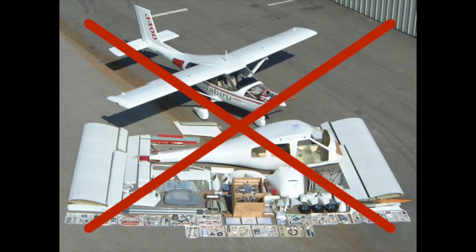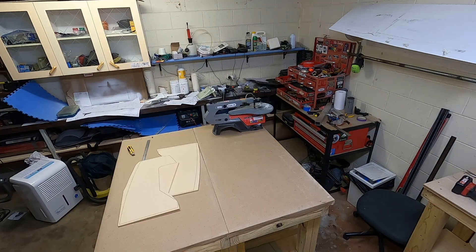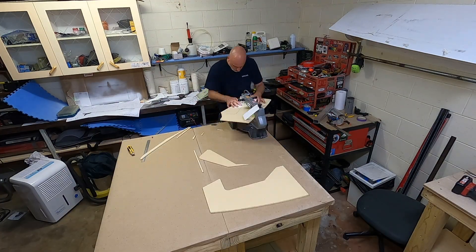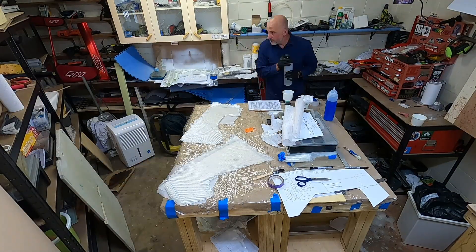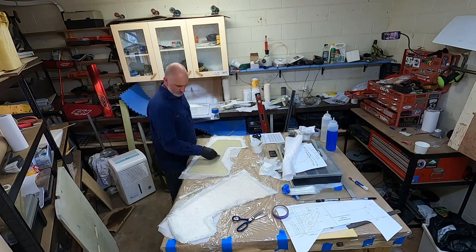As far as building the Cozy, it's definitely not a kit-built aircraft — it's constructed by following a set of plans with detailed instructions on how to build each piece step-by-step. Building a piece of the Cozy usually involves cutting and shaping a piece of foam, like PVC or extruded polystyrene, and then applying fiberglass layups to it using epoxy. This gives the finished part a surprising amount of strength, and when the individual parts are joined together, the result is an extremely safe, strong aircraft.